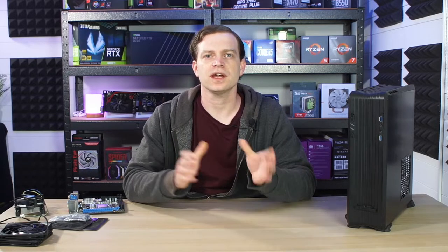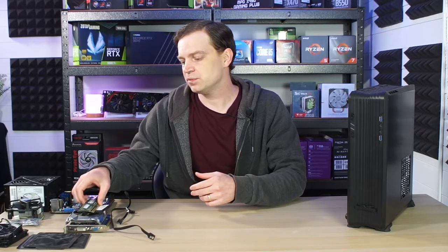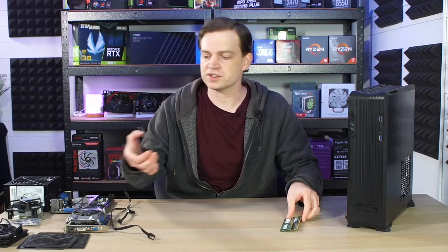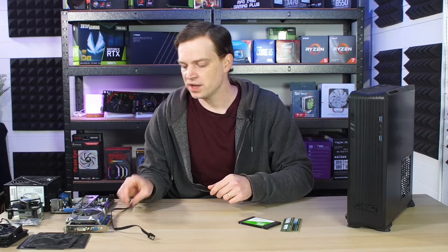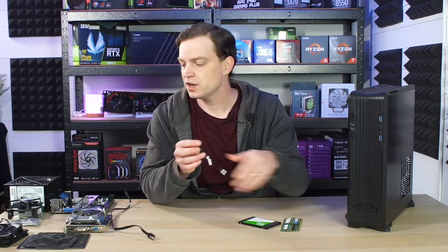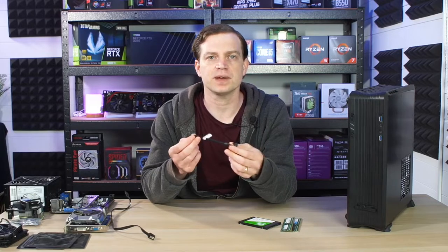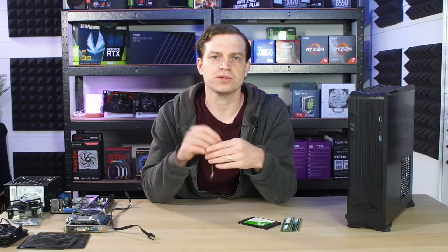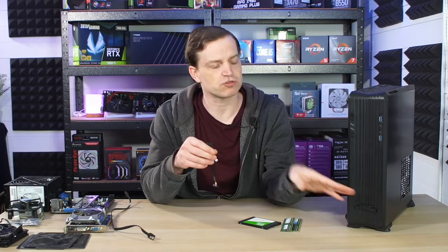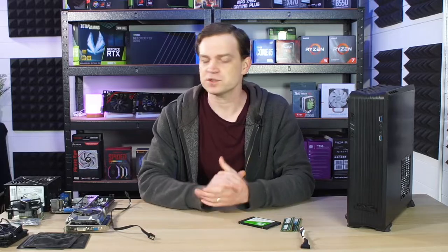Now all we need to do is take the old machine apart, get all the parts out and build the new one. Now that we've got the old machine apart, we've got everything that we need here. We've got our 16 gigabytes of DDR3, we've got our SSD which we did the installation on before. We also had to purchase a USB 3 adapter because this case has a USB 3 connection on the front whereas our motherboard doesn't support that — it only supports USB 2. This cost about three or four pounds from eBay. We're going to lose the USB 3 functionality but it's just enough to get a controller working in this system. Purchasing that brought us to a grand total of about £49, so that's an absolute bargain.